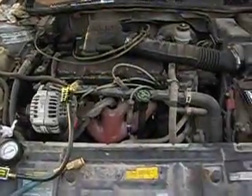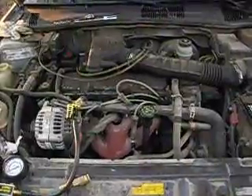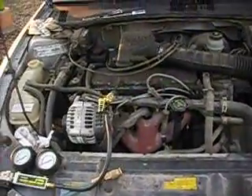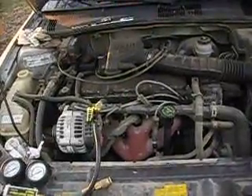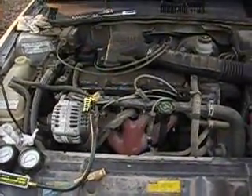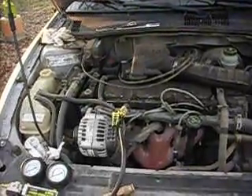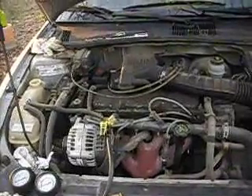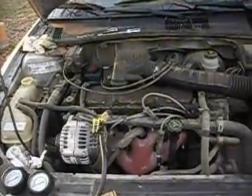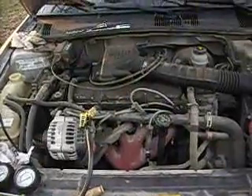The reason I didn't do a simple compression test is that a compression check will only tell you whether or not you have adequate cylinder compression. If you have a drop-off or a complete lack of compression, it'll tell you — hey, you've got 20 PSI where you should have 100 or 120, or you have 0 PSI — obviously there's a problem. But a compression test will not indicate where the leakage is going. It could be going past the rings into the crankcase, past the head gasket into the coolant system, outside the block, or through the intake or exhaust valve. There are a lot of different places you could be losing compression. A compression check tells you whether you've got adequate compression, but not where the loss is located.